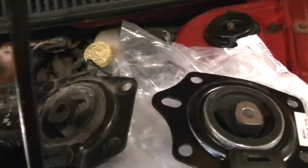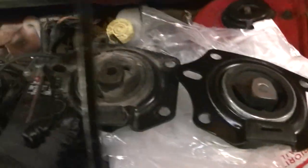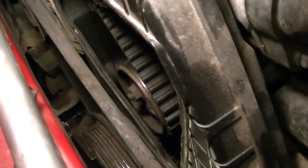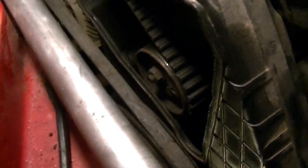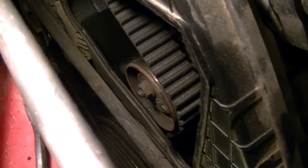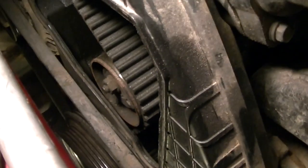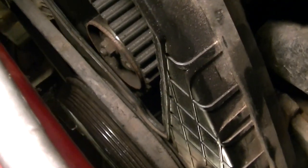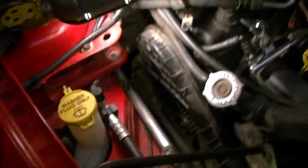Now all I have to do is put it in. It wasn't too bad overall, but beware when pulling things out — try not to break the cover. This is also a great time to inspect your timing belt. Check for tears, dry rot, and general condition. Mine is making no noise and looks like new, so it's in good shape. Putting the mount back in will be easier than removal.